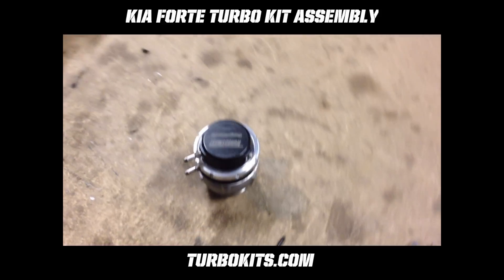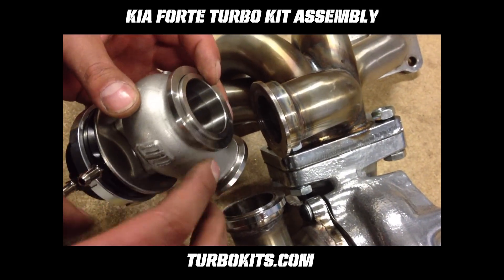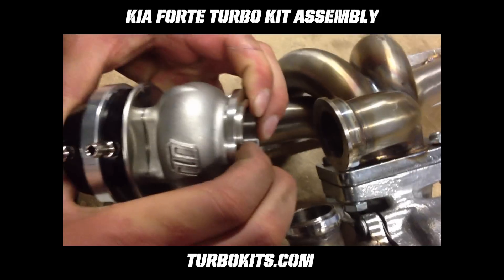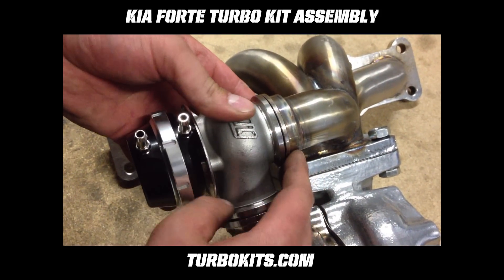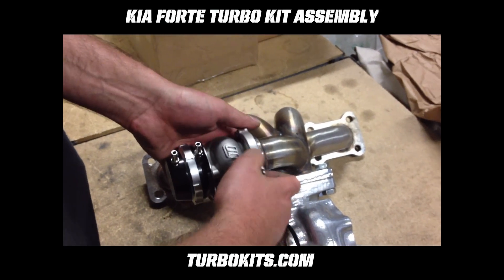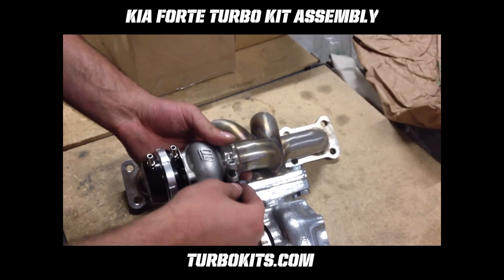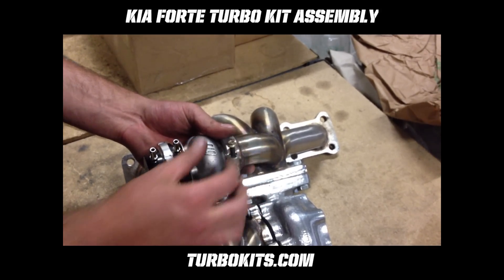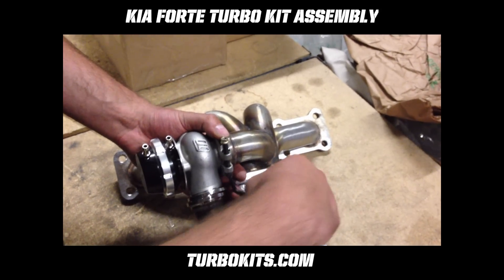And there you go — capped on the right, ported on the left. When you put this onto the mating V-band flange, you'll see there's a little ring at the bottom. That ring precedes the spring, so when you connect it, it will push in. Don't worry if there's a tiny gap at first — as you push it in and tighten it down, that gap will close. There is a nut side and a bolt side on the V-band clamp, so make sure you're using the right side. There's a pocket available for you to fit a wrench around on the bolt side.